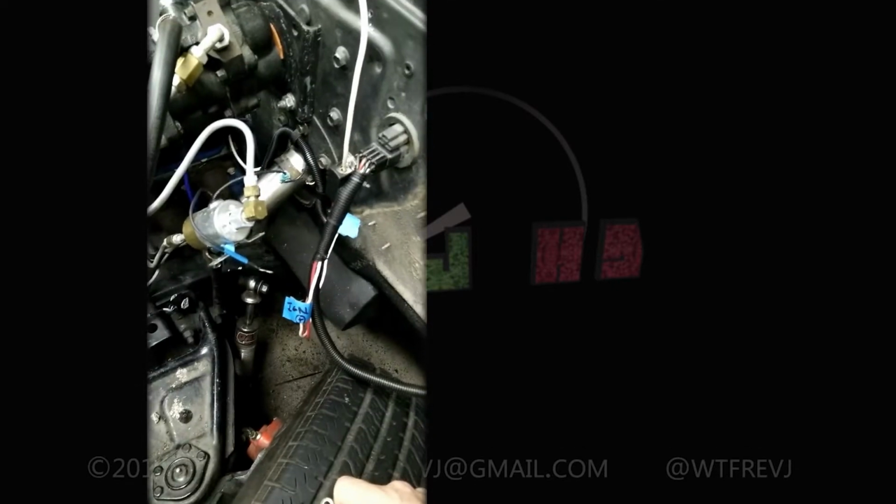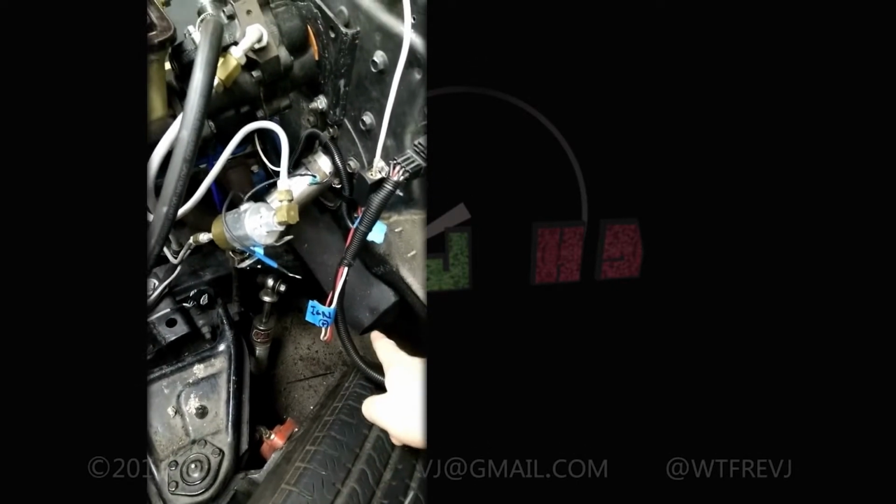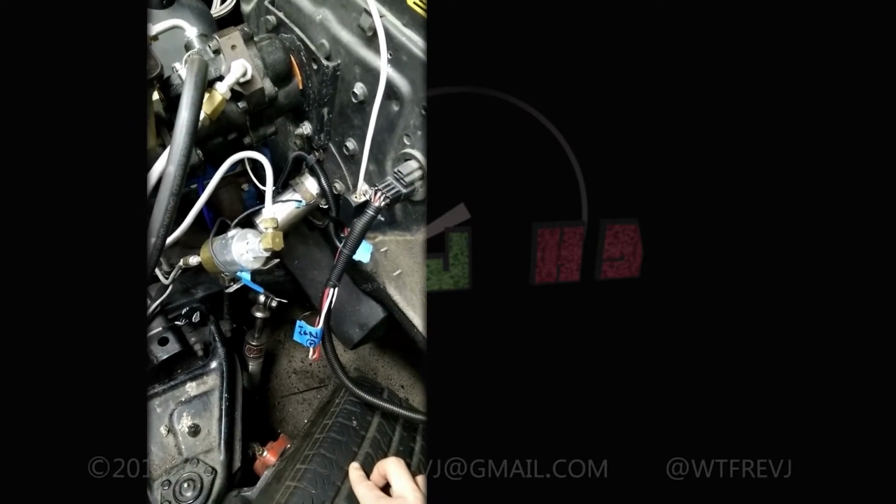We actually sectioned the entire floor 3.5 to 5 inches from lower to upper to allow for some more legroom, and I will show you guys the inside to kind of explain what I mean here. So it definitely wasn't a project we wanted to have to do, but I've had 2 back surgeries. If you guys don't know, I have bone cancer, so I've actually had 2 to 3 of my spinal discs removed. So I needed more legroom, and these 60s cabs and these single cab trucks just don't have a lot to offer. They weren't doing a lot of extended cab trucks or anything back then.